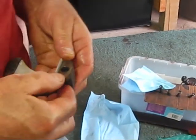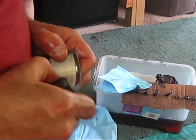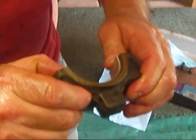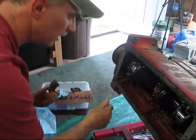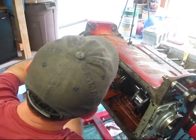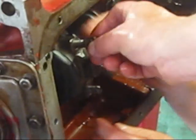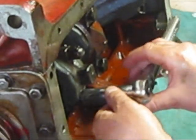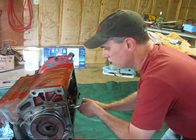Come to this side, try to make sure it's all leveled up. That's as straight as it's going to get right there. Pocket to pocket — this one's going to have the crush where it wants to be a little higher on the other side. It's going to squeeze right into the other one. Number one here goes towards the cam side. I need a little assembly lube on — just a dab. Number one nut, hand start. We're going to hand start everything and come back and torque it all later. Our first piston is in — three more to go. Got all the pistons in, got them all torqued down. Castle nuts with their pins.